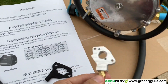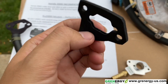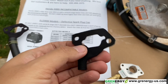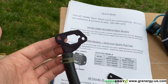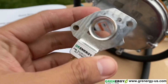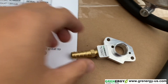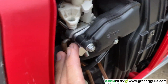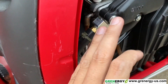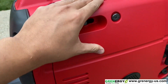The second thing would be the fuel adapter. Here's that brand — at first I wasn't quite sure what this was made out of, but then it dawned on me: this is 3D-printed plastic, unknown plastic. If you want a good quality kit, you should have great brass fittings, quality regulators, and good quality hose — but then you come to this and it's just plastic. You can't have that. So I had this machined from a solid piece of T6061 aluminum. It sandwiches between the carburetor and the air box and comes with all the hardware to bolt on perfectly fine, and the cover bolts over just perfectly fine.